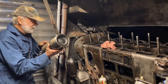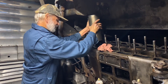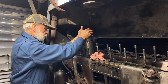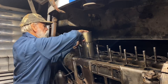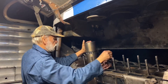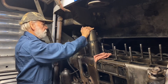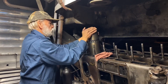Go ahead and start sliding it in. Number one, just to confirm, is facing you, right? Yep. Try to go slow with it. He's stuck — tip it, go back and forth with it. It's probably not aligned yet. Just keep doing that back and forth until it gets properly aligned, and then it's going to want to just come down the hole. Make sure you have a hold of it because we don't want to drop it — you will nick the crank.